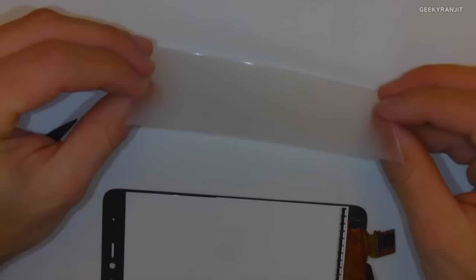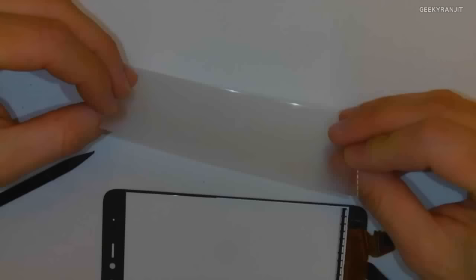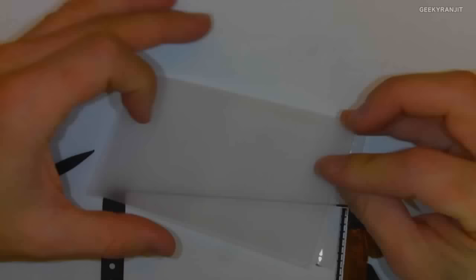So this is kind of like those lenses that you hold up. Do you know what I'm talking about? I don't know how to call those. It's pretty common as a kid's toy. So this is pretty thin. I'm guessing this is about 0.3 millimeters. It's actually the thickest part of the display. And what it does, like I said earlier, is it basically turns the light around. So it's a pretty interesting surface that just basically guides the light out.